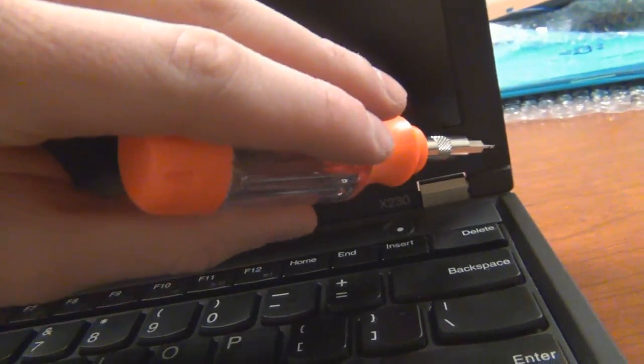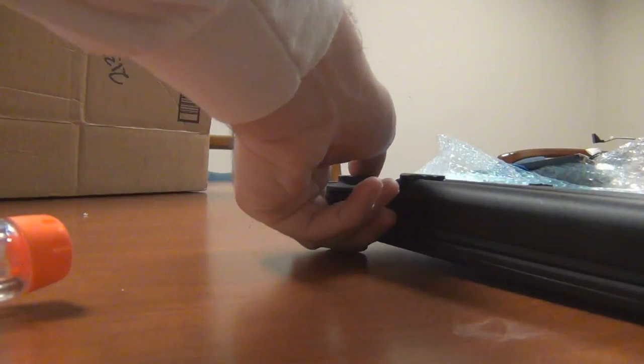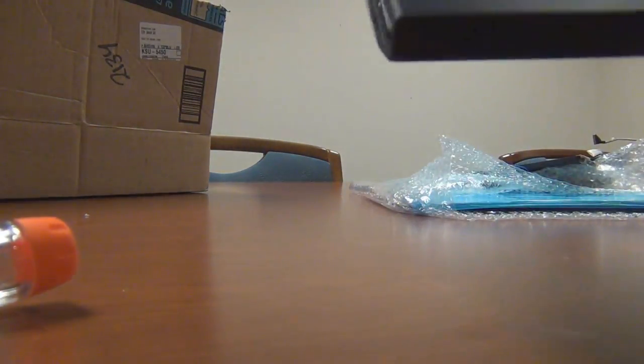The greatest thing about this mod is that we don't even have to really take the laptop apart in order to replace the screen. All we really have to do is take these two little plastic pieces out, remove the two screws underneath, and then this entire front bezel just pops off with snaps. One thing it might help to do is take the battery out first. So just pop the battery out, so that this thing doesn't start up on us while we're replacing the display.